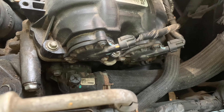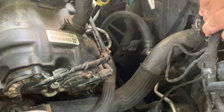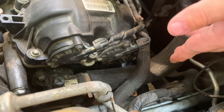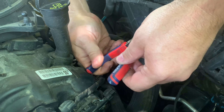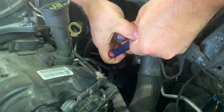The first thing you need to do is remove this plastic cover off the top of the engine — it just pops up just like that. I'm going to lay it to the side, and then you will have access down in here to the whole engine. You'll see right here is where I'm going to need to get to — that is where the alternator is.